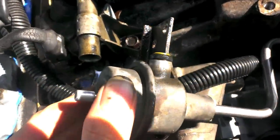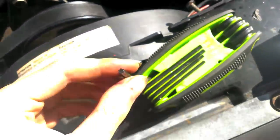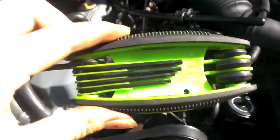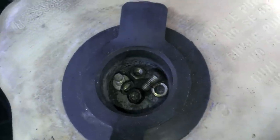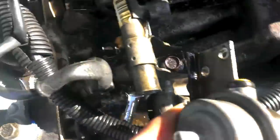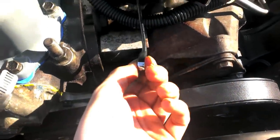The fuel pressure regulator is off. There's just two of these guys. It's a six-star — I think that's a security hex or whatever — the size is a T25. It's got two nuts on the back of the bracket which are really small; they are 5/16ths. So it's tiny stuff. Make sure you have a magnet grabber so they don't disappear. It's just a bracket — you don't have to move the injectors or anything. You just need a really small wrench to get in between and under there.